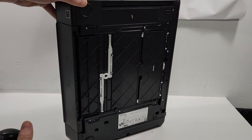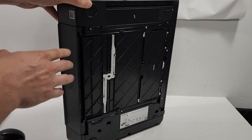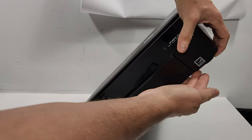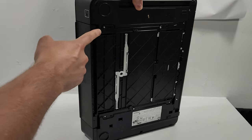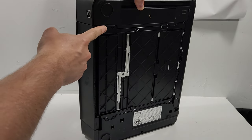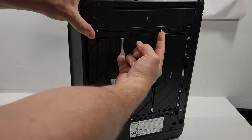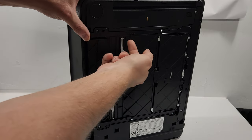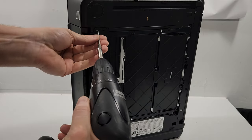You do not need to remove all of them — you just need to remove one. If you're looking at the printer on its side, it's going to be on the right side. The reason for choosing that screw is because there's a longer gap between the two screws, and that gives you more area to work with so you can just lift a little and remove the tray.